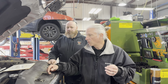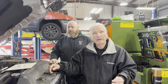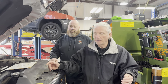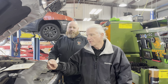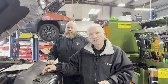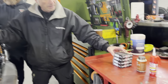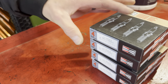One of the things right off the bat that we're going to talk about is the brand of spark plug. Years ago it didn't really matter that much — you could just put Autolite in everything. Those days are gone. You really need to be a little more specific about what you're going to put in. So in this Chrysler, we're going to use Champion spark plugs. You could use other brands also in this one, but we're going to put Champions in this one.